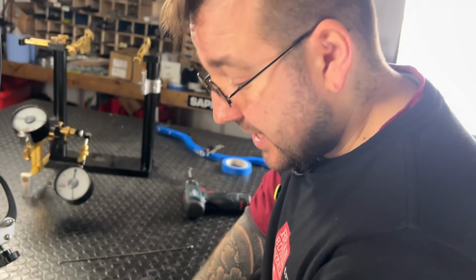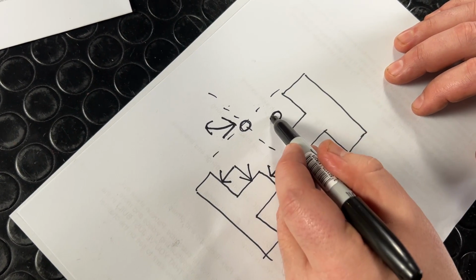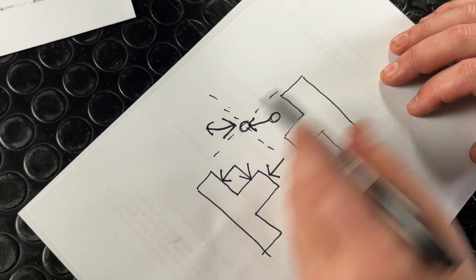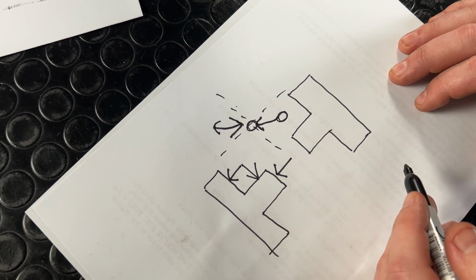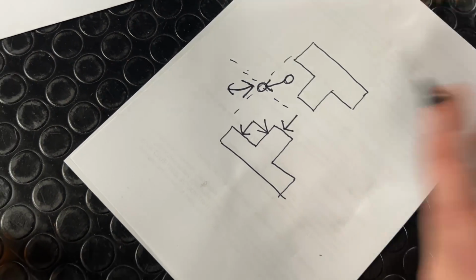Conversely, let's say that you found that your rim ended up down and to the right. You know that it needs to come up, therefore you can add tension, and you could do that on your left-hand side. I think you get the idea. It's much simpler to try it out in practice. Grab that cup of tea again, give it a go.